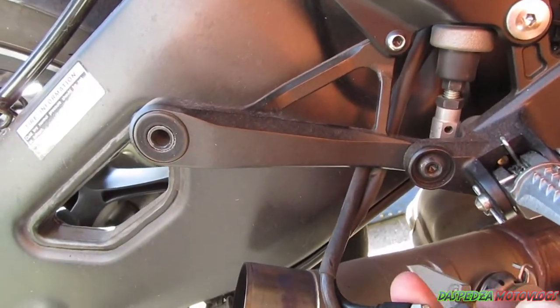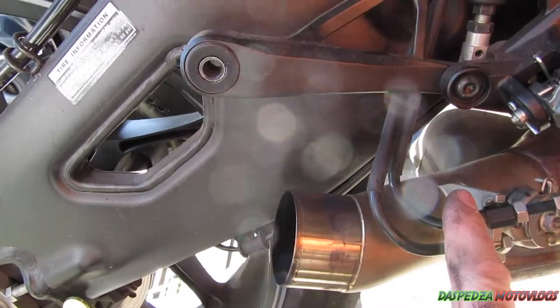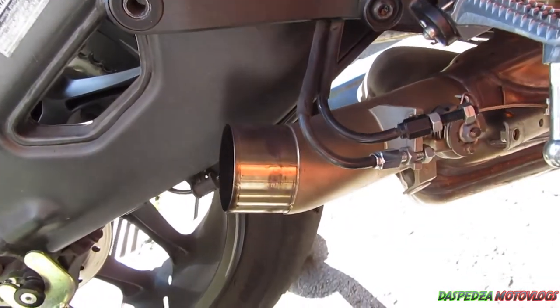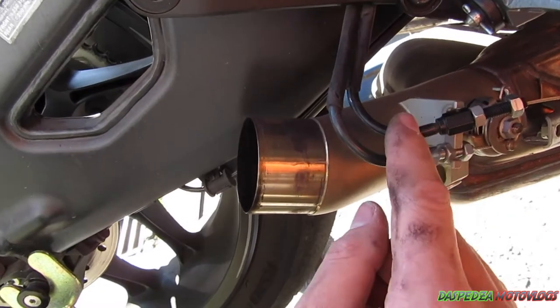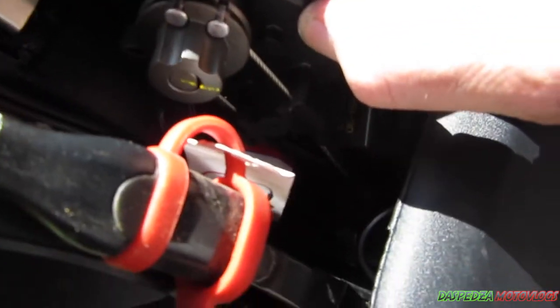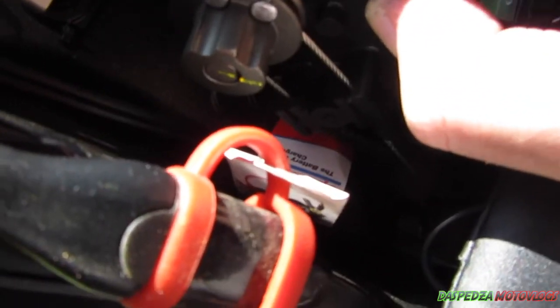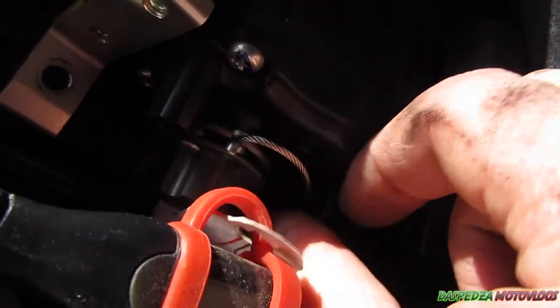Here's the tricky part — you've now got to figure out which cable goes where at the servo, so if you ever have to put this back together you remember which way it goes. I've taken a picture: black is on top, silver's on the bottom. Up at the servo end you can't see that, so once you've loosened one off, try and see which one has the play. This is the top one — as you can see, as I'm pulling on that it's moving that cable.